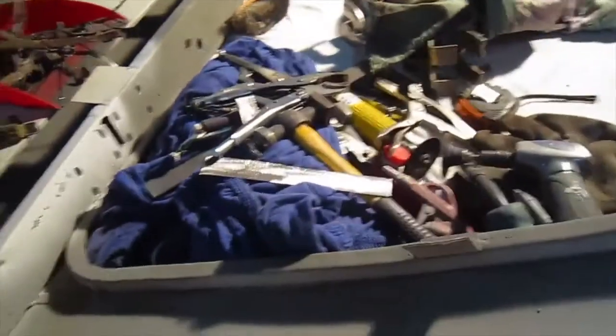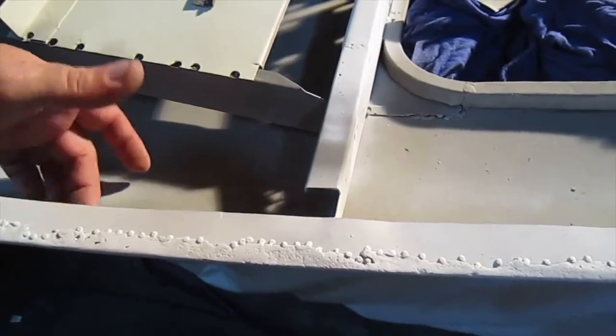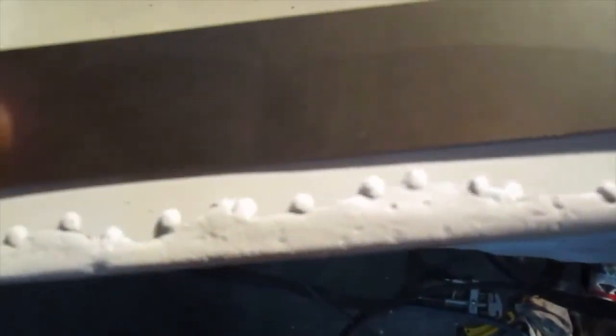Once I find everything is okay and it's going to work — it just needs some slight cutting but I know it will fit on the back of the tonneau — I'll then re-weld everything, every other weld. Then when it's on the car, this will be welded to the lip on the car, and spot welded here. And then what we'll do is lead load right the way across the gap — I'll catch this side and this side — but it'll all be spot welded in place first, and you can see that will take up those bad areas there.